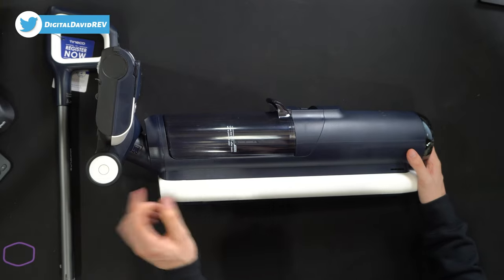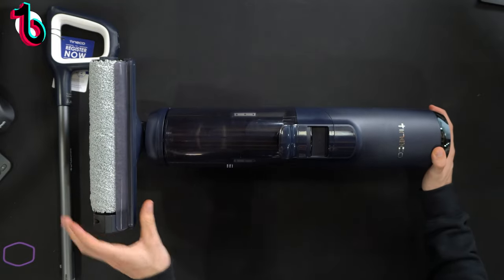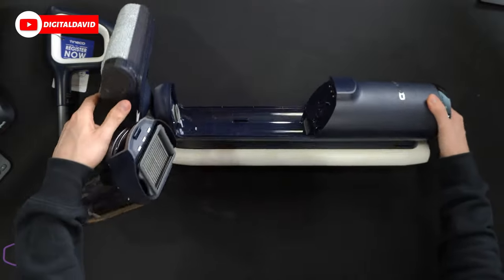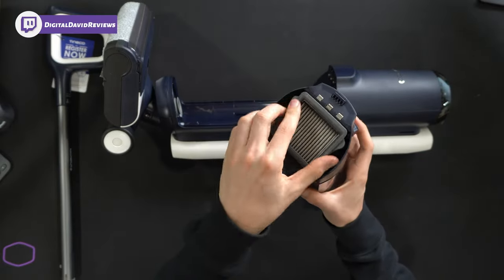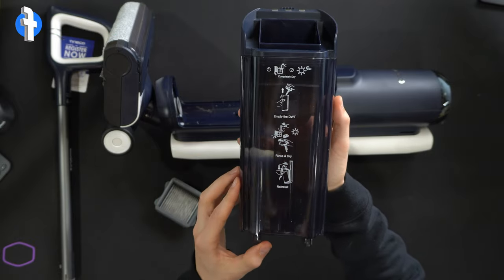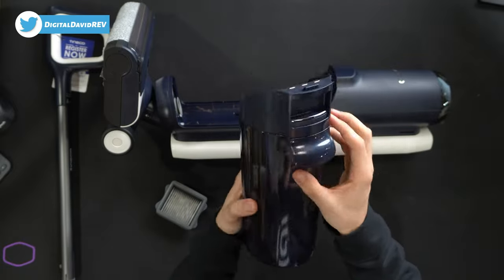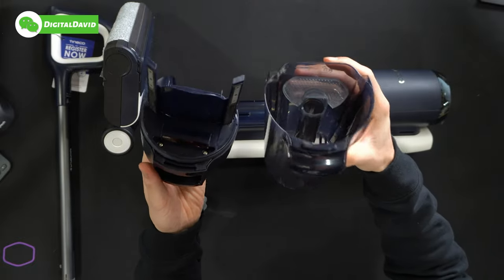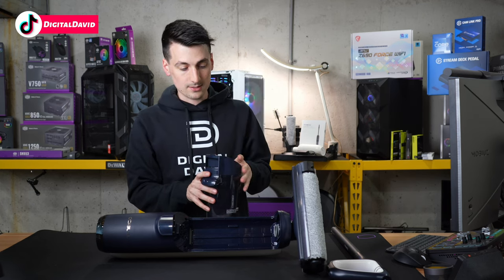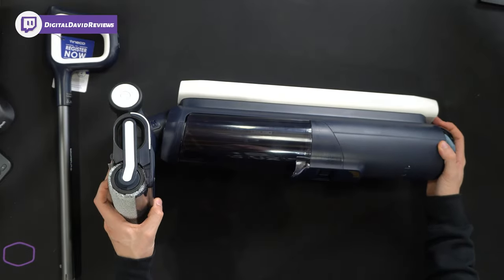Now we can look at it from the side. You can see our dirty water tank — more of our beautiful blue color with our max line letting us know when it's going to be full. Here it is from the front with the logo and branding up top. We can easily remove the dirty water tank — it comes out very easily. We have a filter as well that we can easily wash and clean. We have instructions for making sure we clean out our dirty water tank, rinse it, and let it dry for a full 24 hours before reinstalling. You do not want to leave dirty water sitting in this tank — it will definitely start to smell. That's true of all wet-dry vacs, so definitely clean this after every use.